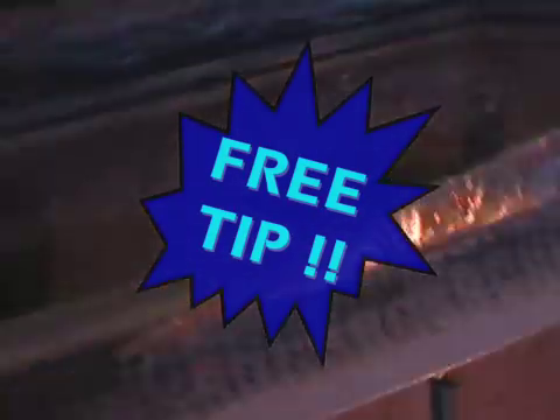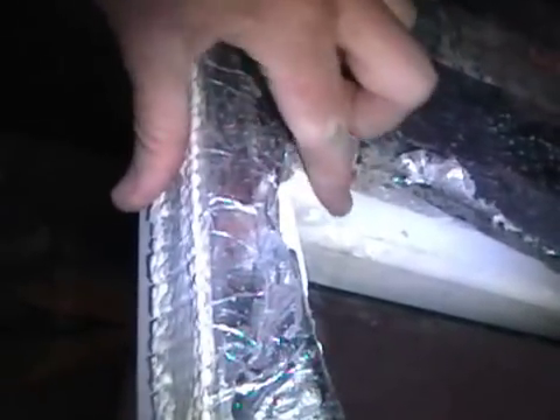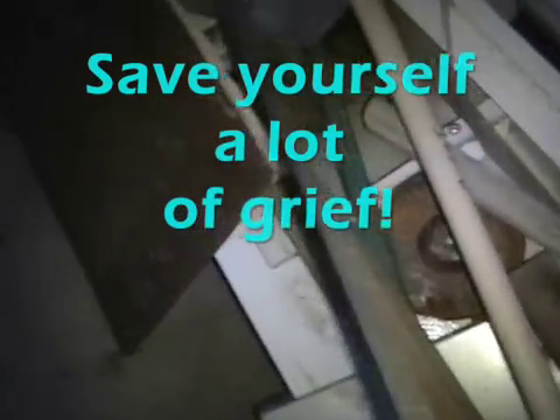I do want to give a little warning, a free tip to you do-it-yourselfers out there. On this refrigerator part that I cut, there's a little bump right here at the top, and there's a huge piece of heavy-duty steel that runs all along the top. When you cut it, don't cut up as high as I did — cut down just about an inch lower. You can tell where to cut where that bump ends, so cut right back there. Otherwise you're going to run into that steel reinforcer. I had to cut through it because I didn't go down low enough on the side panel, and that was tough — it took me three days to cut through because my arms kept tingling from the sawzall.